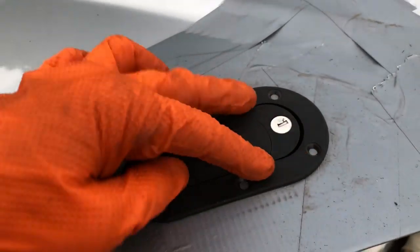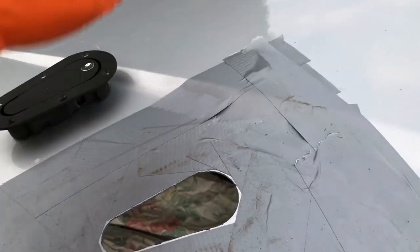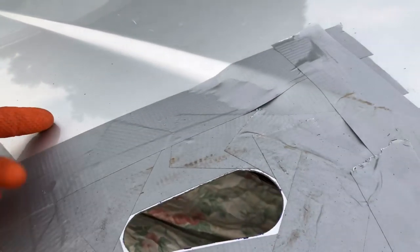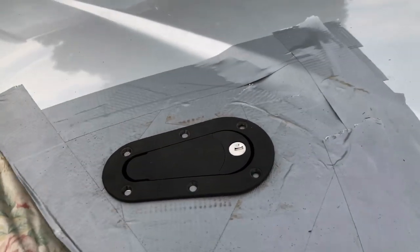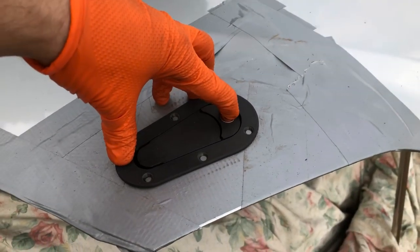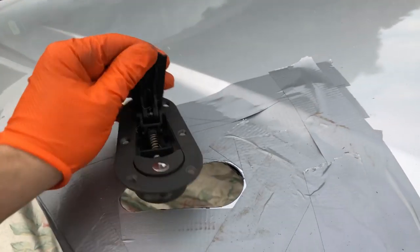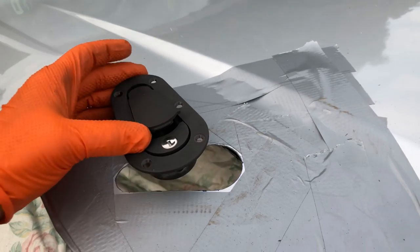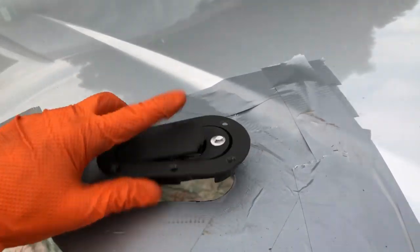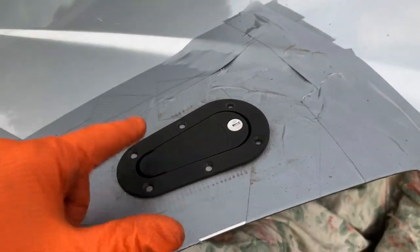Now I'll mark out the holes and drill with the tape still on - that stops the drill bit slipping, because if it slips it'll scrape all the way down the paintwork. I've also turned the aero catches round on this bonnet. Normally because they're sideways it doesn't matter, but you can't have an aero catch that way round because the air blows against the catch - if you leave it half open there's a slight possibility it pops up while driving. Sideways you won't have that problem. Most of my bonnets I do with the catches that way round, but I thought I'd change them around this time because the big end looks a little bit smoother and tidier.